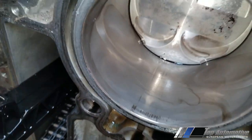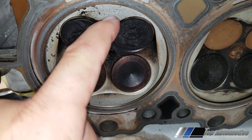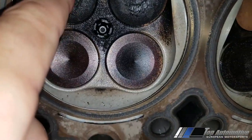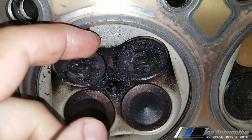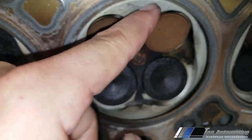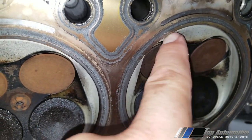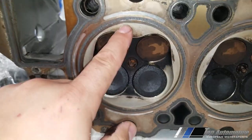Here's the head — this area is cylinder one, the one consuming all that oil. You can definitely see some crazy caking right here, and that piston has been hitting here as well. This area is smooth, but this is rough — my nail catches it. The exhaust side is rough; it's not as bad on bank one.